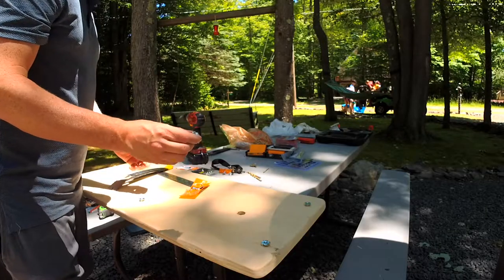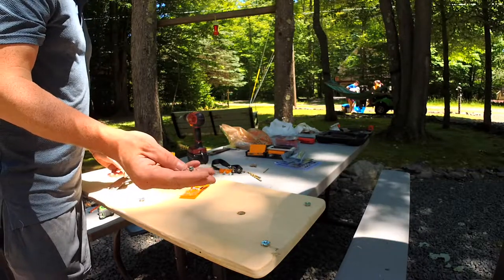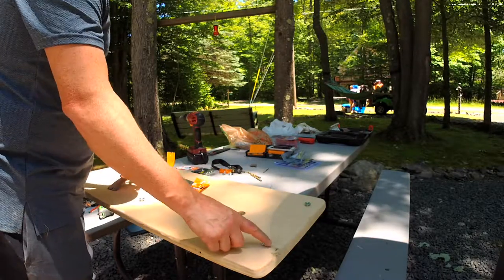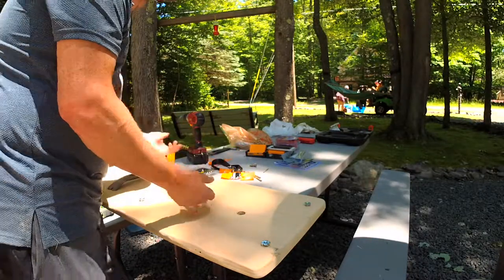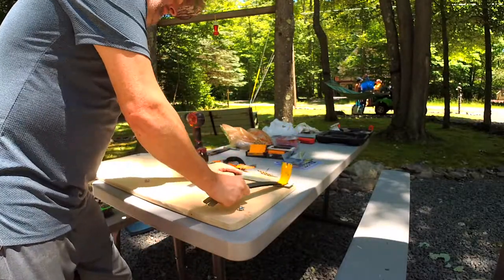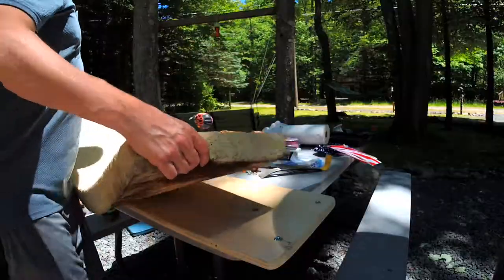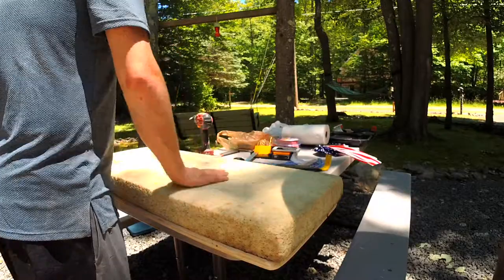In this step I'm going to use quarter-inch by 5/16th T-nut fasteners. I opted to use new ones — I didn't want to dig out the old ones, so this is just an easier step. I put them directly in the holes I drilled from the rear of my golf cart, just lined them straight up. These are quarter-inch by 5/16th — use the ones appropriate for your golf cart. I'm improvising a bit since I have limited tools at this vacation home, but as you can see, it's a perfect fit, nice and flush. They're not going to feel those fasteners.